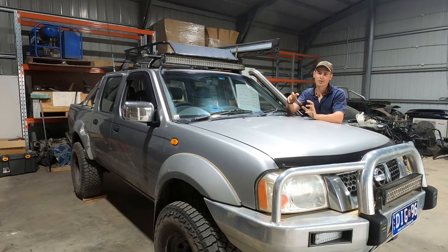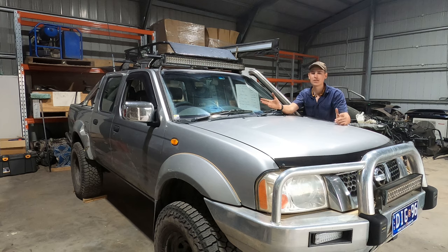It sort of helps that I've got an intercooler, which means extra intake volume. All that boost fills up the intake, fills up the intercooler — fills up everything on the intake side to, I think, 22 PSI topped out. Then your revs drop so suddenly the engine's not breathing as much air, so it has to be spat back out. When you come off throttle you're not building boost, boost wants to get out, it comes through the turbo — and that's when you get that flutter noise.